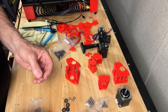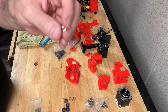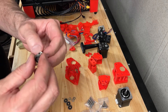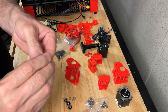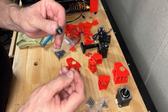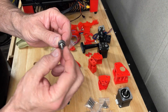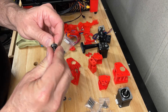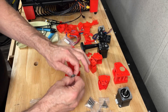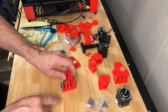Now I'm going to show you the way I do it. If you look at that bearing, there's a kind of a rounded-off side and then there's a side that's got kind of sharp edges. I do mine so that the rounded side touches the bearing. Drop that on there, then take a bearing plain side down and slide it down against it. Next bearing, flange side up, slide it down. Shim with the smooth side towards the bearing, down. Another shim smooth side away, towards this bearing, flange down, flange up. And finally the last shim on here. Drop this on - that's your bearing stack for the right side.